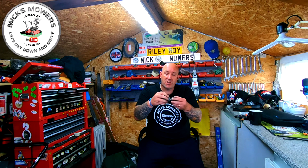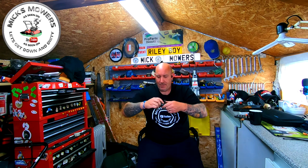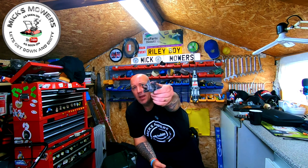Now, I've done two or three videos on these, and now I'm confident that the repair is successful, okay? So what you're looking for is to replace, I would say, the pinion gear. If you're gonna do this job anyway, it's gonna pay to do the pinion gear, because the pinion gear runs inside this brass bushing, okay? This is the old style kit. I'll get it off just by my hand. So that's the old kit, okay, just there.